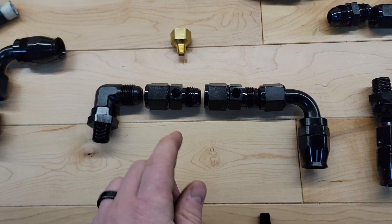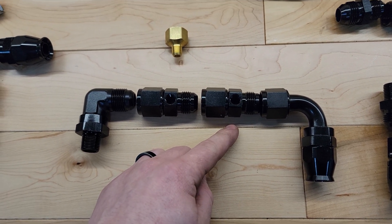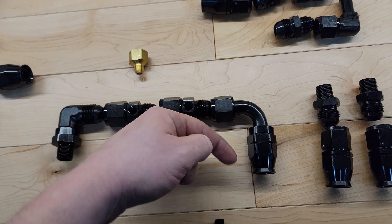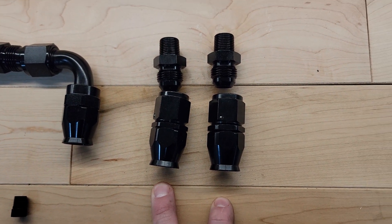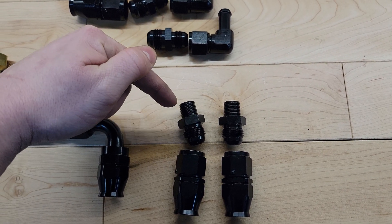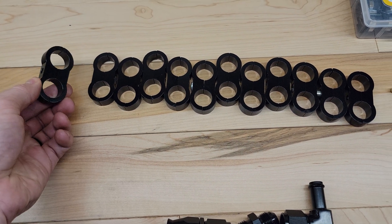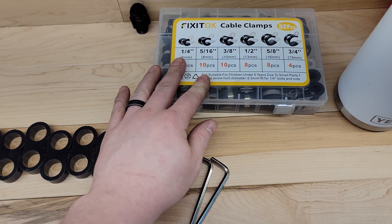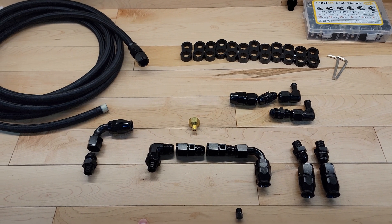The stock sensor is 3/8 MPT, so I've got this brass fitting that goes from 1/8-inch MPT to 3/8 MPT female. I'm also going to run another one because my current transmission temperature sensor is on the passenger side — it's better to run it in the hot outlet line of the transmission. That's a 1/8-inch MPT sensor so I'm just going to put it in there. Then I go into the 90-degree 10AN and run the hose from it across. I also have these line separators to use at certain routing points to keep the hoses separated, and hose clamps to attach to a fixed point so nothing's rubbing and the lines are kept out of the way from getting damaged.